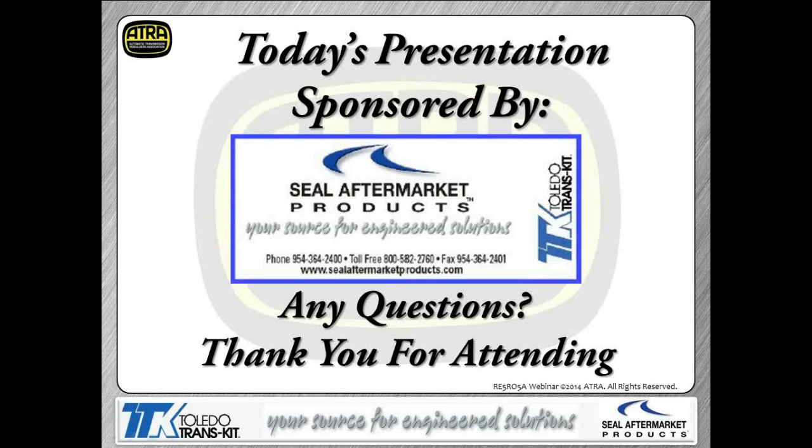What we found, the general rule, is the 5-pinion steel planets are mostly found in the truck vehicles. The 4-pinion or aluminum planets are found in cars. We have a 4 and 5-pinion center planet. And take a look at this center ring gear. We have 1 tooth count difference between them. So there's 2 of them. You might be able to put one up against the other and look down through the inside to see if the teeth match up, but I would still count them to make sure.